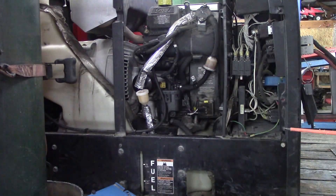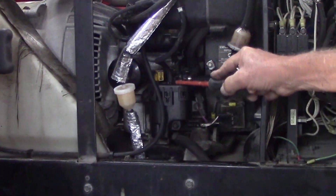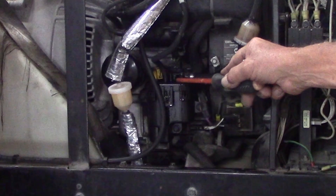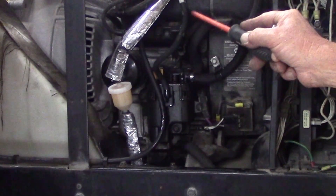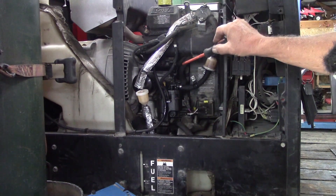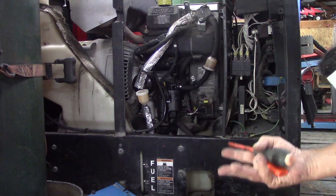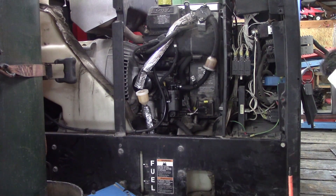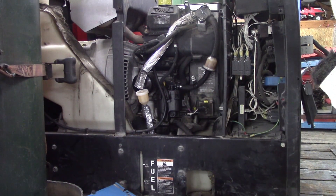What's happening is on the fuel pump it's pumping gas out of the vent on the top. Pop that off and you can see gas just gushing out of there. The vent goes up to a T-fitting, splits off — one side goes up to the throttle body and the other goes back into the top of the gas tank. It's just a vent hole; there's not supposed to be gasoline spraying out of this thing. So there's something wrong with the fuel pump.